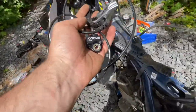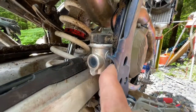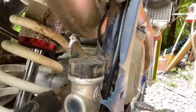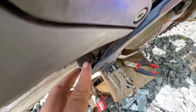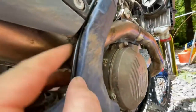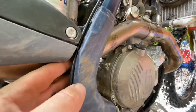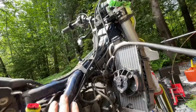I'm thinking I'll take the small end and feed it through and get it down. I'm pondering a bit where to route this wire. I actually find this little area right here works pretty good — it seems to be a natural channel for it. I did Dremel out right through here and I'm going outside away from the exhaust. Might as well keep it away, and then just zip tie right here. It's pretty high and tight.